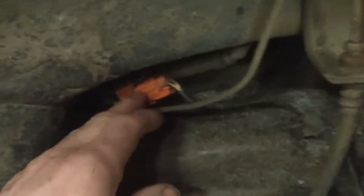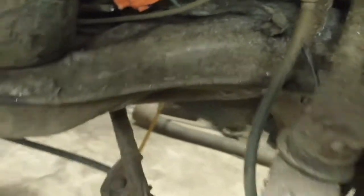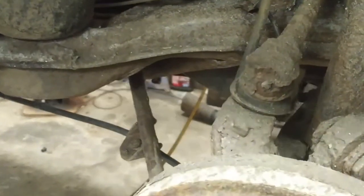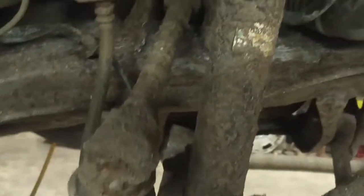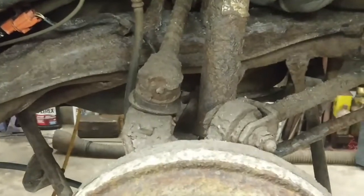We disconnect the ABS wires and brake hoses and possibly the brake cables. I might just drop the subframe enough and leave it supported on the jack stand, because the gas tank is quite low on fuel so it shouldn't be that heavy. We also need to drop the exhaust.